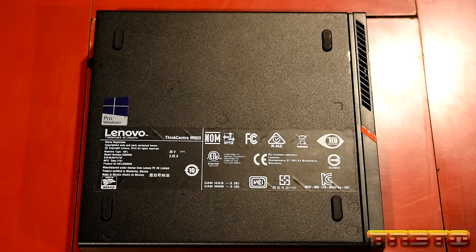No operating system found. So now I want to boot the system off. So I'll just turn it off. I'm going to go ahead and put the cover back on the unit because we know the unit's all ready to go. And I'm going to pop in my Ventoy drive and we're going to boot MemTest86 Pro. And we're going to test the RAM. So that's the next stage of the game.